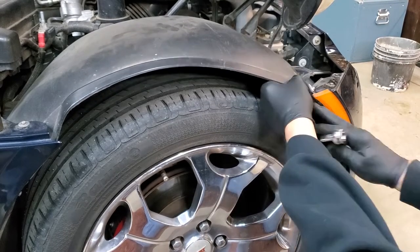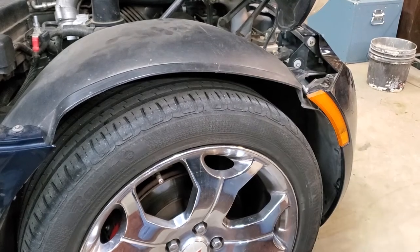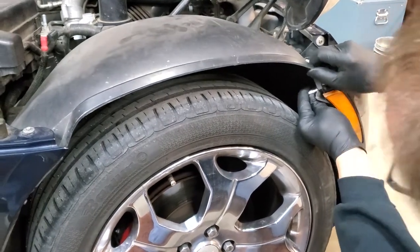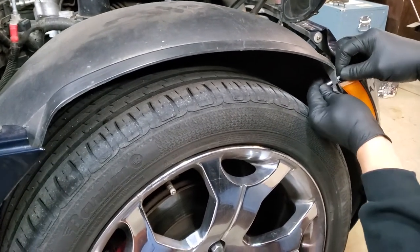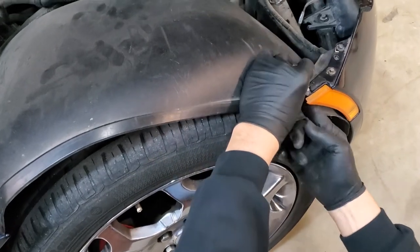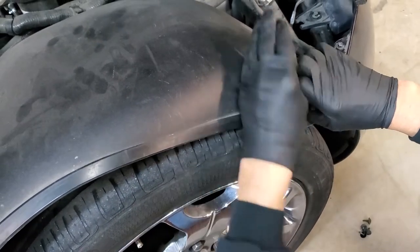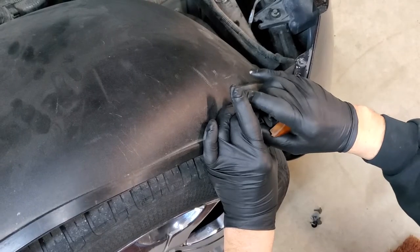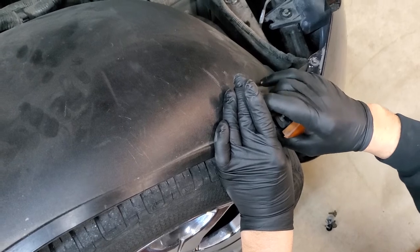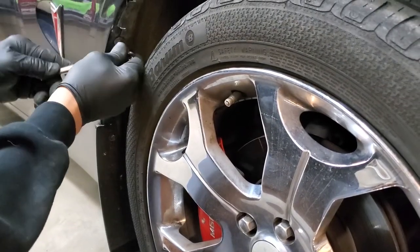The next one we're going to work on is this one. You notice how worn out the fender liner is — it's just pieces here, so the bolt isn't even holding anything. I've got to get the little thing out; I'll take my socket off and try to get a hold of it. Because this fender liner is so beat up, I decided to just push it down and unscrew the piece that way instead. I'm putting upward pressure with my left thumb while screwing it out with my right hand — the ratchet would actually make this more difficult. And that's out.